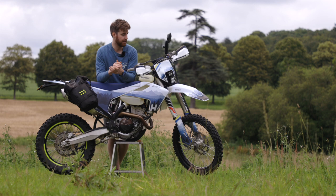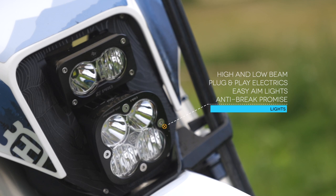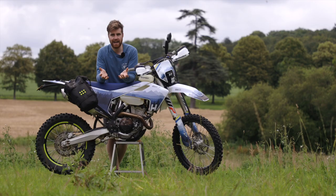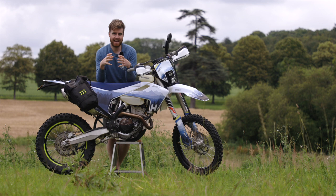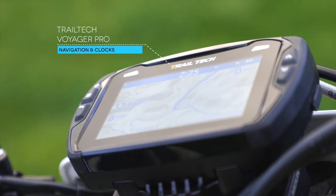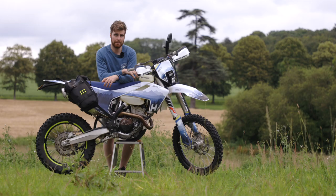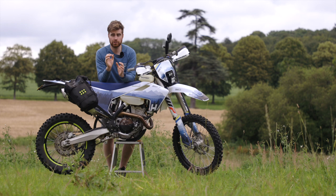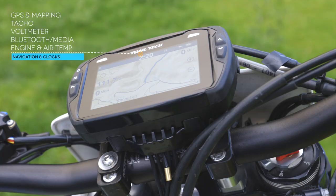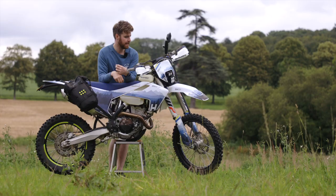I've got high and low beam, which is also very nice. So if we need to do any night riding — hopefully we don't, it's summertime here — but if we do need to, I know that I've got a good headlight to get me out of that situation, because the stock one is, honestly, a candle. For the nav solution, there's always a few options — you can use your phone, you can use your GPS. But because there's no way to easily power a phone off a dirt bike, I really wanted something more integrated. I chose the Trailtech Voyager Pro, because I think it's going to be better than something like a Montana — purely because it gives a really simple bike a little bit more than the stock clocks do. We have speed, bike temperature, the ability to hook your phone and your music up and control it all through that. It's a really integrated unit and I really like it for extending the functionality of this, making it a little bit more adventure friendly. It also has really good mapping features, which is quite important for a GPS style device.